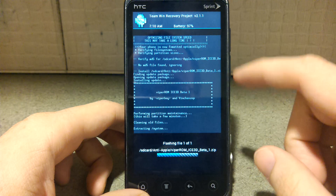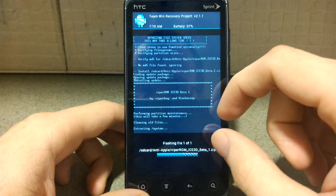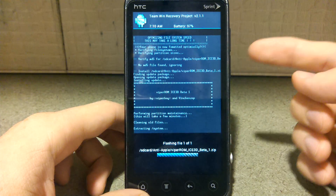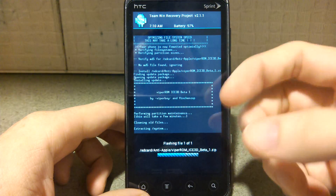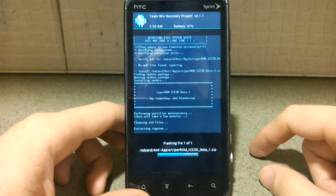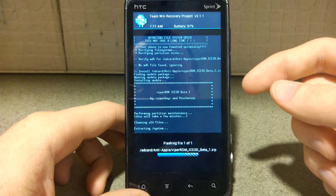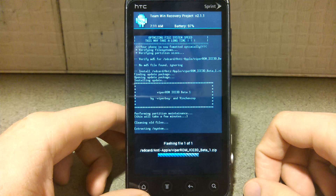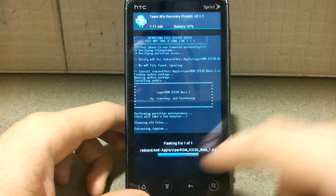Right after all this is done, instead of rebooting the system I'm gonna shut down, because once you boot to bootloader the PG86 — whatever it's called — is going to automatically start and ask do you want to start the update or cancel it. If you cancel, you reboot the system. So it's like you've got to remove the file from your SD card or boot the system and tell it to reboot to recovery instead of bootloader. To me this is the best method — we'll see.